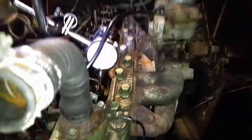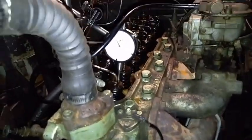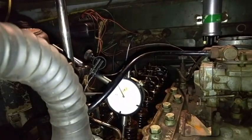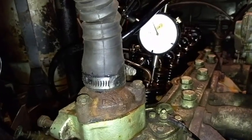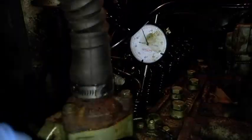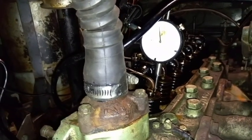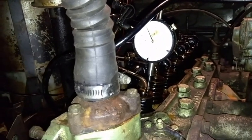Now that the cover's off, I've got my dial indicator set up on the number one exhaust valve, and set it to the EP mark — exhaust peak. If the dial indicator drops down going backwards, it means it's not at peak yet, which would mean it's delayed. I'm going to rotate the engine in the correct direction. If it stays and then moves forwards, that means it's coming back up to peak. I'll bring that in to zero. This is a pretty foolproof check on whether or not the cam timing is out.